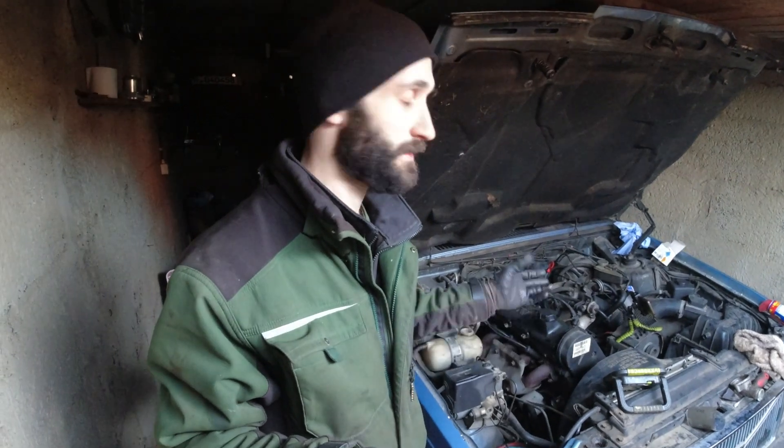So guys, Elsa the 740 — today we're going to have a look at the cooling system. This thing's been sat for 10 years off the road and I don't know when parts were replaced before that. The coolant definitely looks very, very old. The thermostat is at least 10 years old, if not more, and we really don't want that to stick closed and cause the motor to overheat.